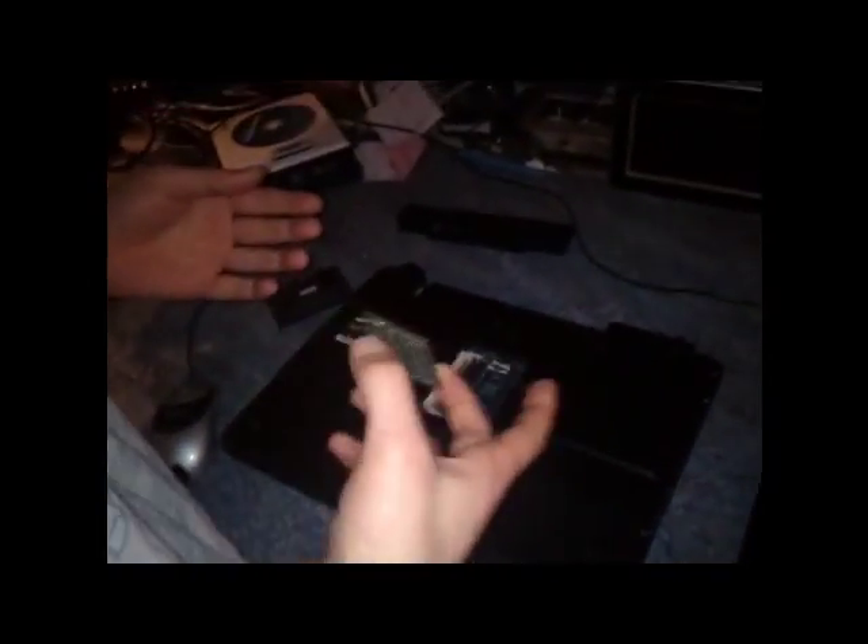To earth yourself, it's as simple as this. You have a computer down here — it's currently plugged in. Make sure it's plugged into the mains. Touch it. You're fine. As long as you're touching the metal part of the computer, you're earthed. You don't necessarily have to do that, but it is a precaution. You can get earth cables that go around your wrist and they have a clip on the end, and they attach themselves to things like radiators. Obviously all the pipework is at some point going to meet the ground, and it's going to earth you.